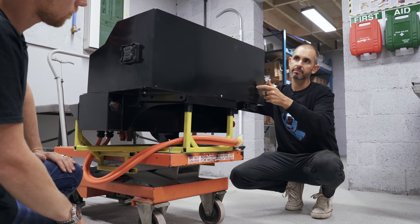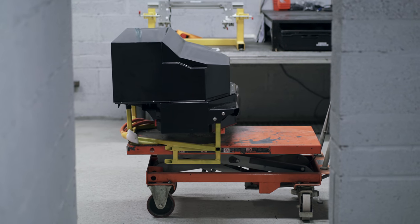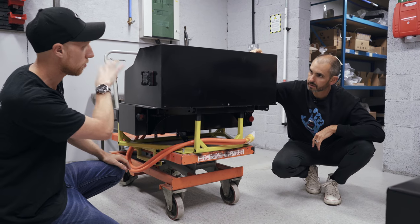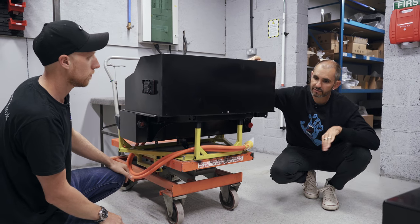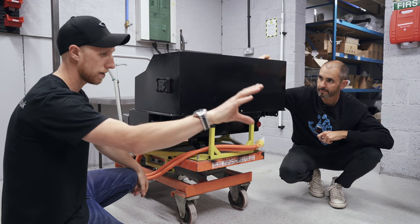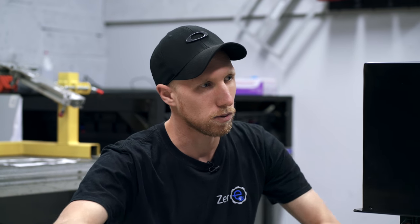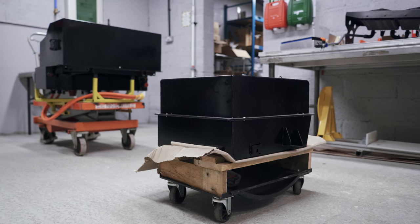This is a steel box — we looked at aluminium but once you go thicker there's just not a huge amount in it. Built into here is all the high voltage junction box system and battery management system — you've not got anything external. It's this steel box. Once it's in, unless you lift the engine bay, you can't tell. Apart from missing the exhaust, you'd have no idea the car's been converted. And the other battery box fits in the front where the fuel tank was, so your spare wheel still fits where it was. Total: 53 kilowatt hours, with a real-world range of about 180 miles.